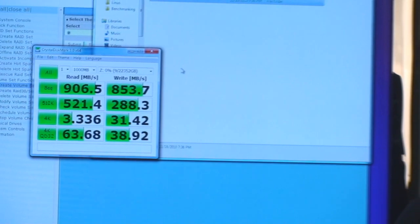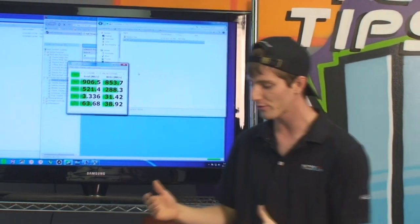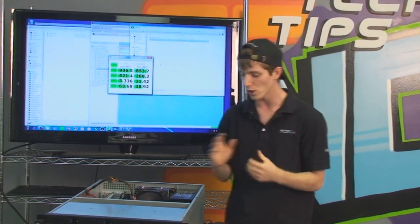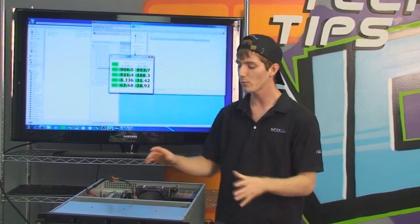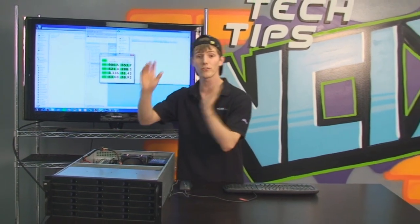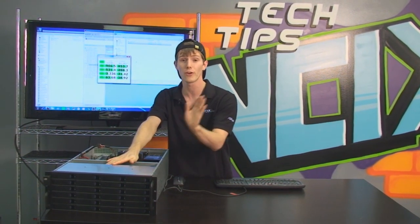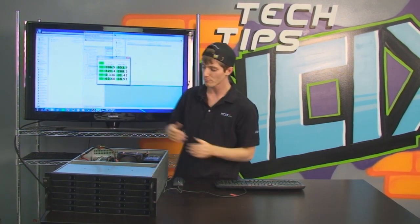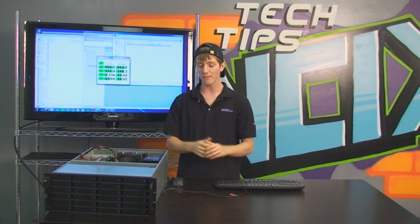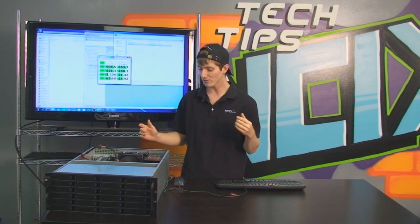It's all performance — never do this, as I mentioned before, but it makes for a neat little demo. The hardware I'm using today isn't something I'd consider proper server-grade hardware, other than the RAID card and the enclosure. This is the kind of thing where you'd actually want a server-grade board and proper server-grade hard drives. I'm just using WD 1TB Blacks, which are not ideal for RAID — this was just for demonstration purposes.